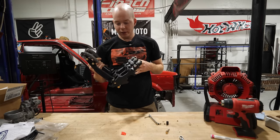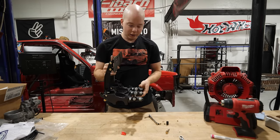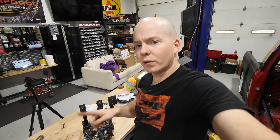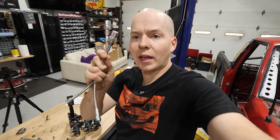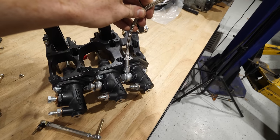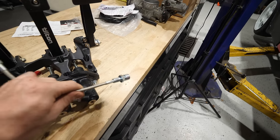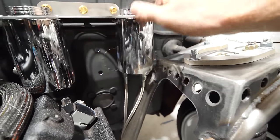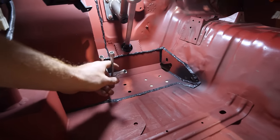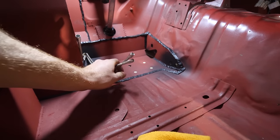We got to get back to work on the truck. Right now I'm working on getting the pedal box fully installed so I can start working on the brake hard lines. There are three master cylinders — one for clutch, two for brakes — which means there are three feed lines and three out lines. Here are the two outlines for the brakes connecting to those banjo bolts, then going into the trans tunnel where they connect to the chassis. The three feed lines coming off this reservoir — problem is I did not buy them long enough, so I bought new ones. I can reuse one of them for the clutch though.